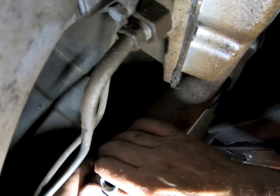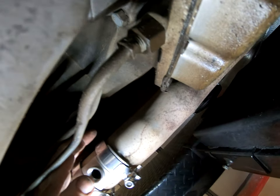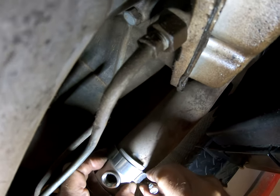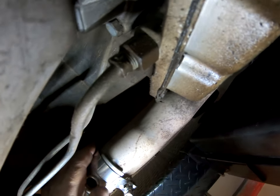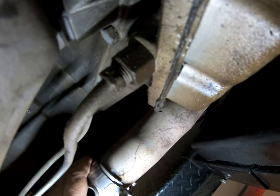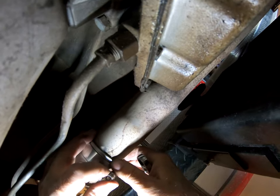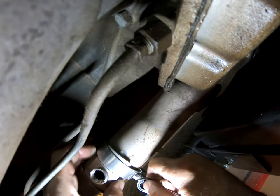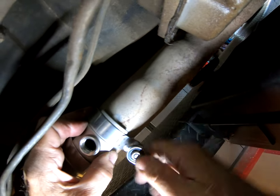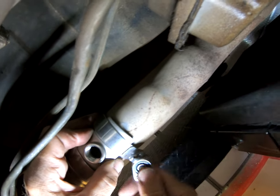Now this is going to be tricky — I did it! Grab your trusty wrench — in this case it's an 11 millimeter. I thought it would have been a 10 but it's not. Just make sure you've got the pad positioned correctly; you don't really want these hanging down, that's not good. I'm trying to keep it out of the way. You can squeeze these up but they've got nylocks on them. You might want to fast forward here — I'm just going to be doing these nuts up and I want to hold this in position.